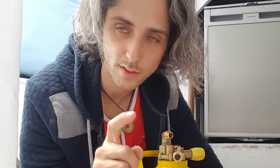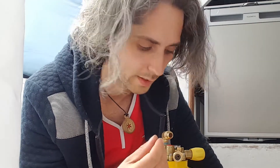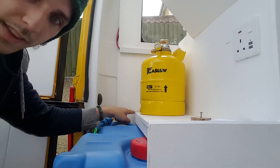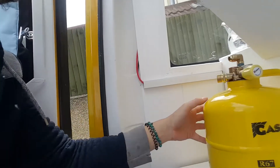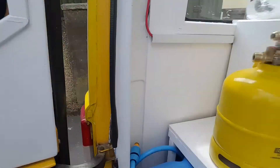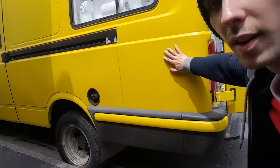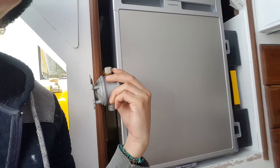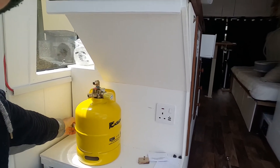If you do this yourself, get some gas spray to check for leaks — it bubbles up and turns blue if there's any gas leaking from your connections. Here's where our can is going. I'm going to use wood, seal it all up, and put a drop vent right in the corner so it hangs over the side. The filler cap will go roughly here, so we'll have petrol, diesel, and LPG all in one place. The regulator is going right in behind here at the back of the fridge.